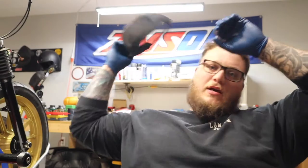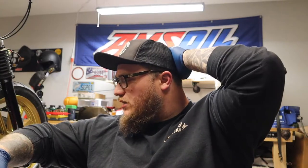Alright, today's the day - tonight is the night I'm gonna dig into this cam chest. I have my service manual so I should be alright, and it'll go step by step on how to do everything and not fuck everything up. Right now I'm draining the oil and transmission fluid - I accidentally did the wrong plug. I'm gonna pop this oil filter off in a second, then take off the right side peg and rear brake lever and disconnect from the brake piston, then dig right into this thing with some 3/16 Allen bits. This might be a long video.